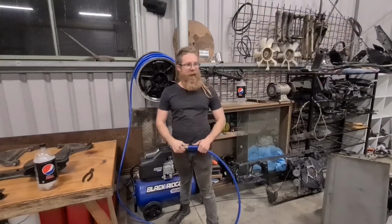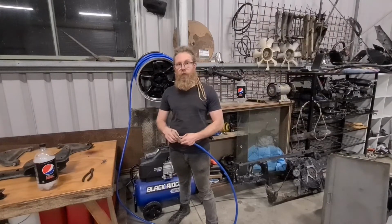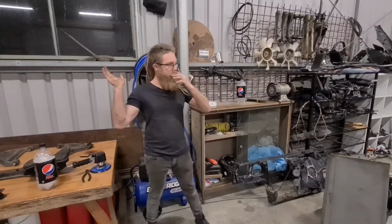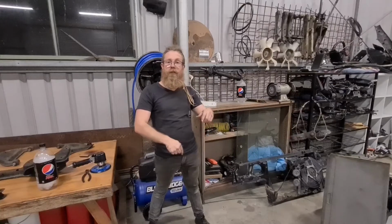I've got to replace the gasket underneath the turbo, trying to just find the reason why the Wagon's not making full boost while we're only getting 16 psi and then creeping when we went to Friday night drifts. But make sure you stay to the end because there'll be some driving footage,